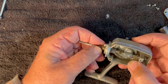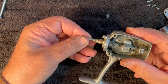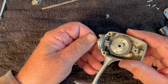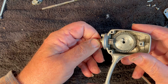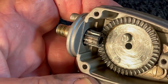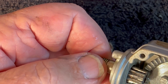We're going to remove the pin. Let's take out the axle shaft. Remove the crosswind block. And that still brings us down to this gear. It looks to me as though the pinion gear is chewed up. That's my first opinion. It doesn't mean I'm right.